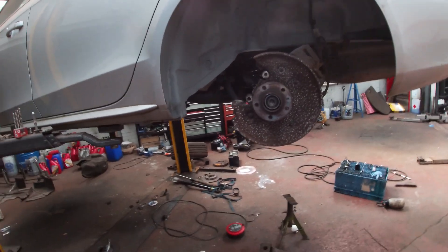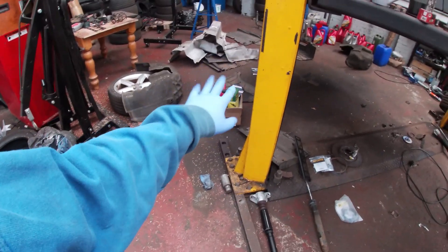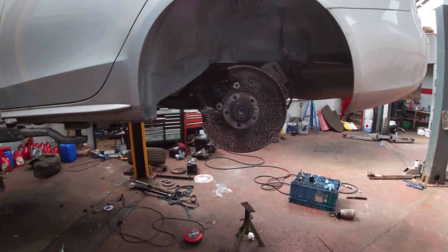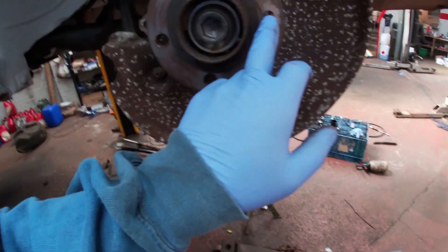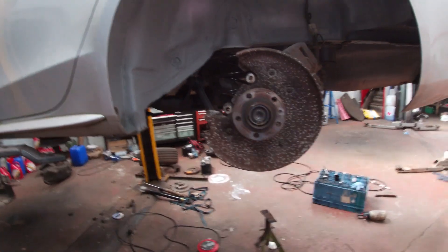If we can get it all off this ramp and get it spun around. We need to put the fuel filter on — I painted the bracket on it as well. We've got a load of bits there, and we need to scope the fuel rail pressure sensors and see where the fault is. So we'll crack on, chip away at this bolt — I'll probably just need to get a punch and punch out what's left of it, then get a clean up with a tap.